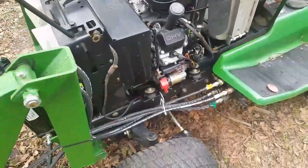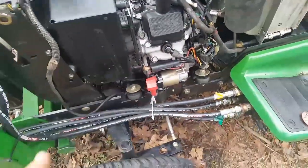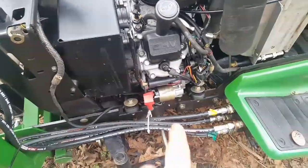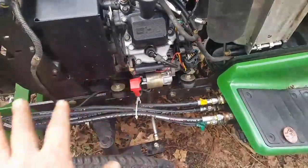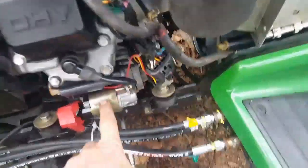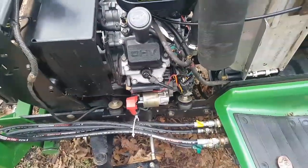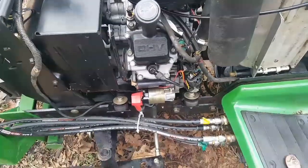I did lose a little bit of time, and it's worth noting this. The solenoid for the starter motor was giving me a problem. Whenever I touched the battery, the ground to connect up the battery, I already had the live lead in place. The starter motor was whirring, and I was getting a spark at the battery. I thought at first I had an electrical short, but it wasn't that. When I'd taken the solenoid away from the starter motor during the rebuild, there's a little peg on the back of the solenoid that needs to hook onto a nylon fork on the starter motor. And it wasn't. It was actually in a fully depressed position. In other words, it was almost like an on position. I guess that was allowing a current to flow.